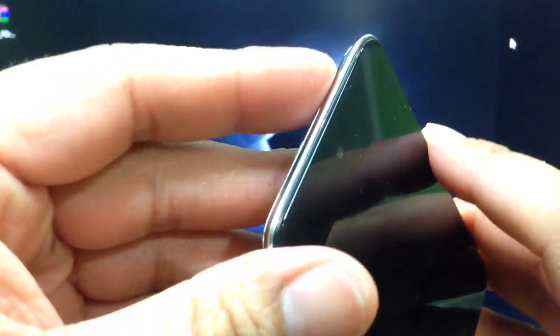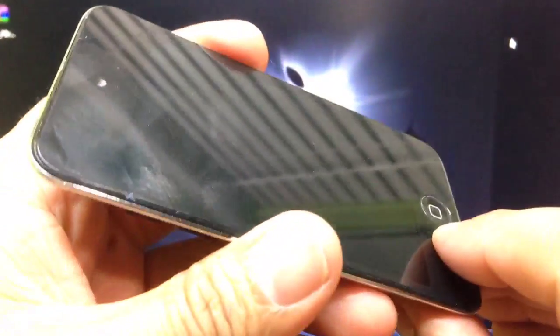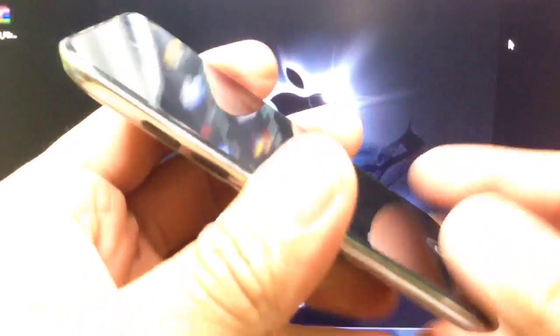So there is a way to fix the power button, but right here in this case it doesn't respond, but there's a click. I'm going to end up replacing the flex cable. So